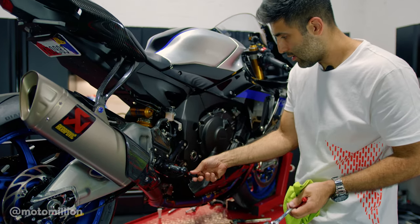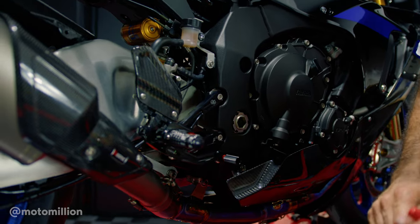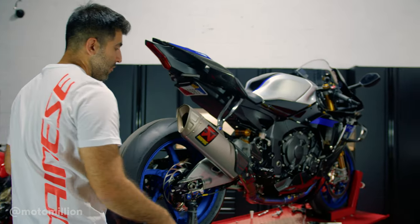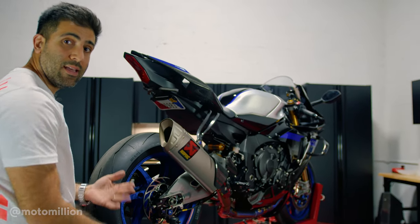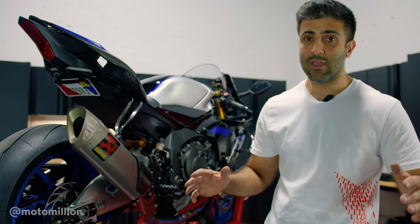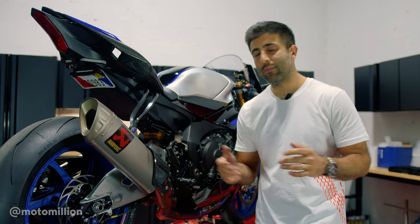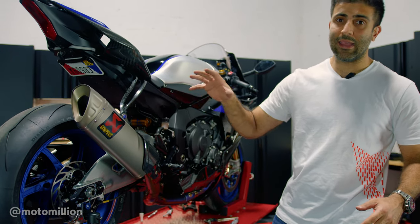I believe this is done. Make sure there's no binding when you're pressing down. This is very, very important — especially if you're running composite wheels. Make sure you have no brake drag, because the minute your brake is dragging, it's generating heat and it's going to cause issues like bearing problems or wearing your rear brakes. Also, carbon fiber wheels do not like heat. Almost all the carbon wheel failures I've seen online have been caused by rear brake drag and that heat going through the wheel.